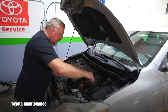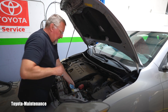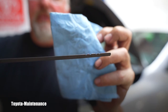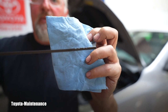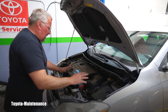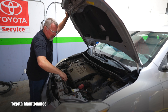You might think it's better to just start the engine, go through the gears multiple times with the foot on the brake, and then measure while the engine is running. You pull the dipstick out - there are cold and warm notches. The bottom ones are for the cold condition and the top ones for the hot, which means operating temperature. I always say it's better to do it when it's hot. We know we put in very close to what was in it, and it was shifting perfectly, so there's no reason to doubt that 2.8 quarts will cause any damage on the test drive.